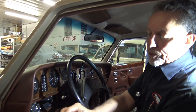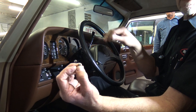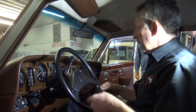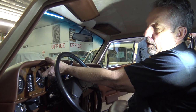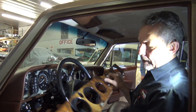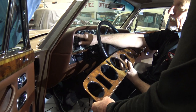So there are three screws — as you can see, they're kind of brown-colored and they've got a finishing washer. Those are the correct screws for this application. And they are machine screws, so they actually screw into a metal-threaded dash, not like a sheet metal screw. Now you gently pull this out. This one came out easy because it's been out more than once. And that's how that's done. So you can see this has a metal dash, so this has the machine screws. How simple it is.